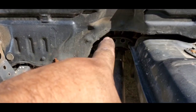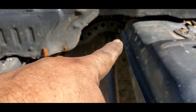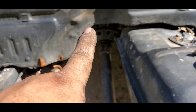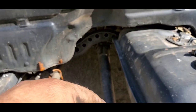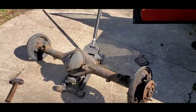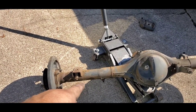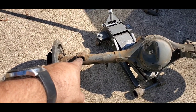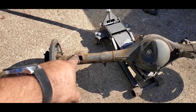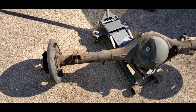On the Mazda, at the back of the cab right there it comes down a little further. So all I did was I took the drive shaft out, put something underneath the cab, and just kept smashing the cab until it cleared. I need to clean this up — right now it's upside down. I need to clean the leaf spring mount off, get that cleaned off. That holds the brake line, so I'm going to have to cut that off and then it'll end up getting re-welded to the axle itself.